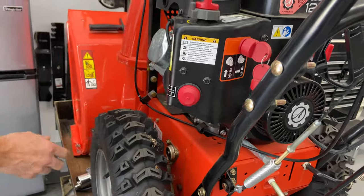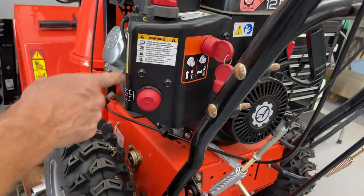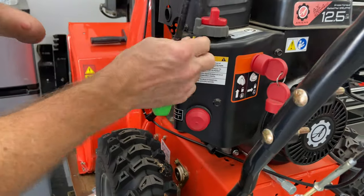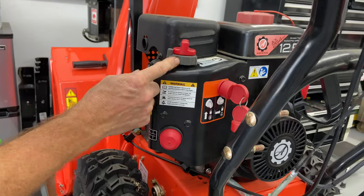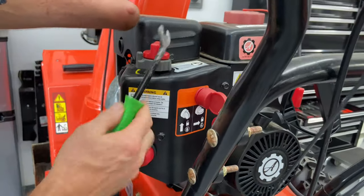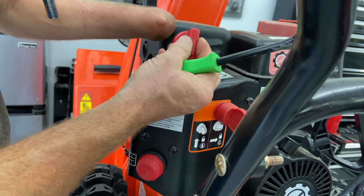So what we want to do is get under here because this is where the carburetor is, and normally all these bolts we're going to be taking off are 10 millimeter socket. The first thing I'm going to do is take off these knobs. Sometimes these knobs come off easy, and sometimes they don't, but I'm going to use my clip fastener tool to push up — just remember which way they go.